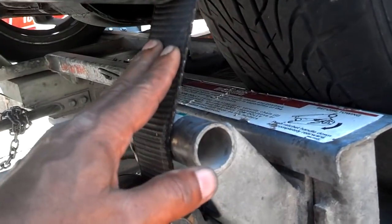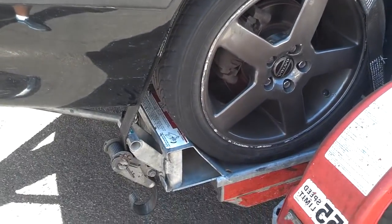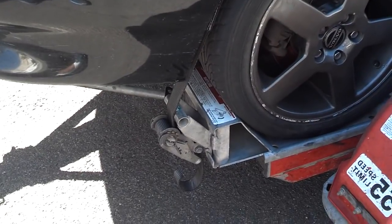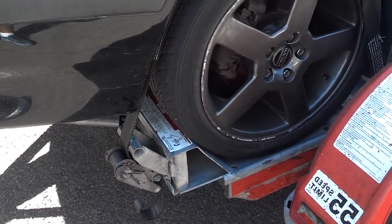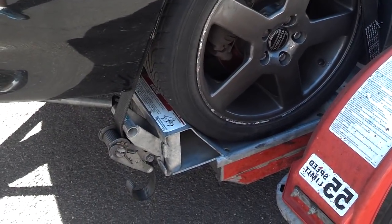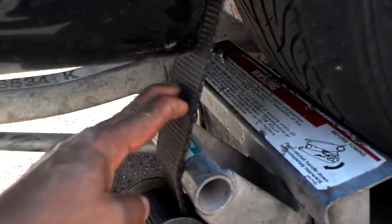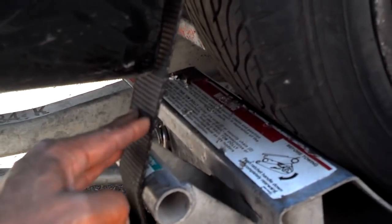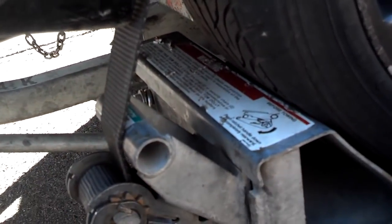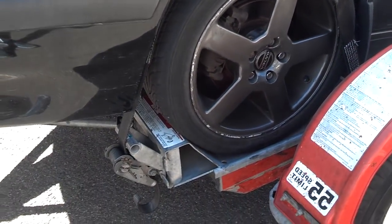Because this is material, it's going to stretch over the next hundred miles or so. So the first time you stop, you want to come and crank that a couple of times. When I drove, I had to tighten it up about three or four times before it was actually tight. You drive a couple hundred miles, this is going to stretch and it's going to be loose. Tighten it back up because you don't want it stretching so much that your car falls off the dolly.